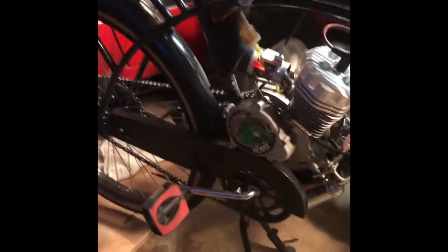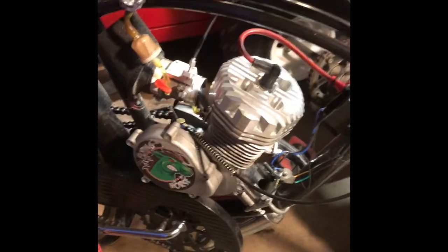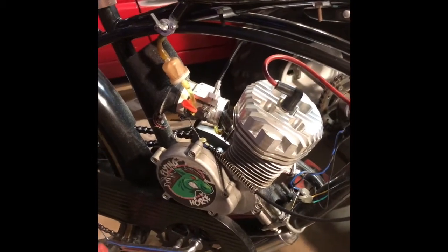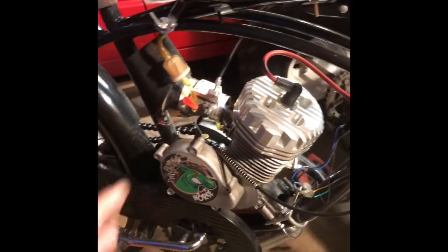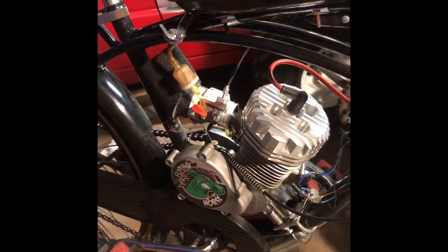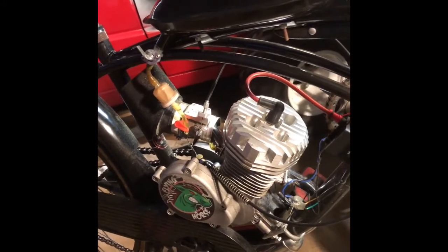I installed a really stopped-up old carburetor - it's a 223, not the one I would prefer to use. I'm actually going to order a larger one that has larger fuel valves inside that dump more fuel. But it definitely picked up a lot more speed with the port job and everything. The carb still runs good and tops out. I went from 27 miles an hour to 35.